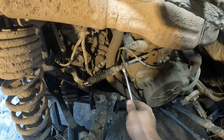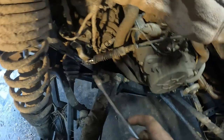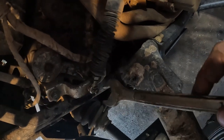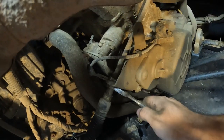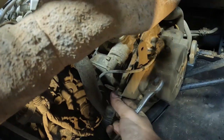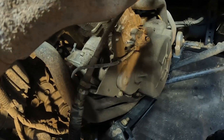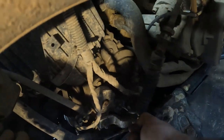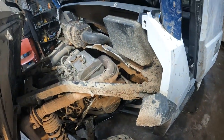I'm going to start right here. I got two 19mm nuts and I'm going to break them loose. Right here at the end there's a little pin you got to pull out. Just loosen these nuts up like this, loosen them up — that should just slide out the top. Then take this pin off right here with your fingers, or a pair of pliers works. Pull that sucker out and then the cable will come off — that end is disconnected from the transmission.